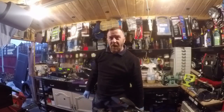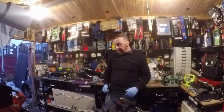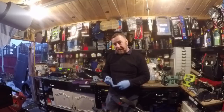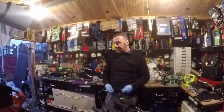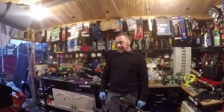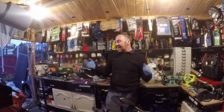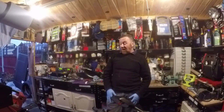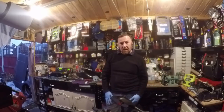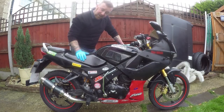There we have a running bike. Tank back up again, carburetor off to find out why the float's stuck open. Obviously from that it's running, so I have to take the plug out again, clean that, clean the whole petrol system through, and now we've got a running bike - happy days. Found out it wasn't sparking but that was due to travelling in transit. Job done. Next will be checking the chain, tire pressures, brakes and everything else. This needs an MOT - this bike runs out in February, a couple of months. No sense in trying to move on a bike for only a couple of months. We're tightening up, getting rid of some crappy stickers.